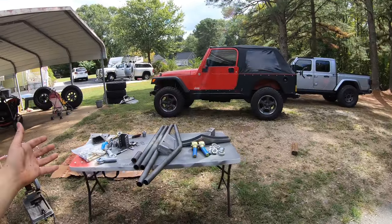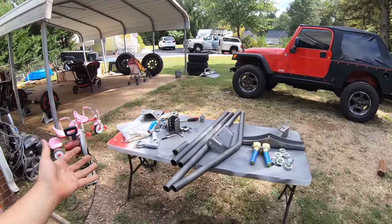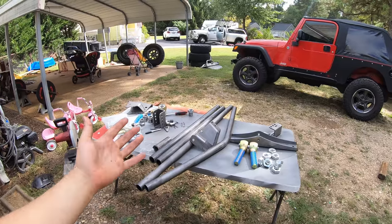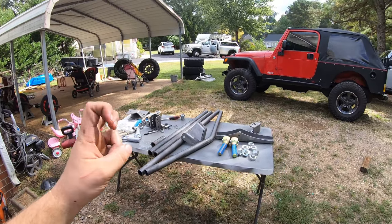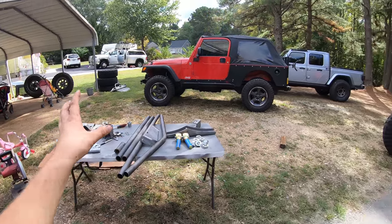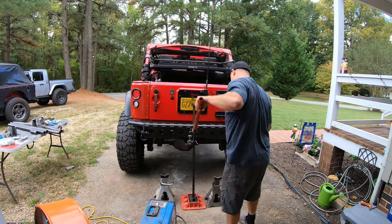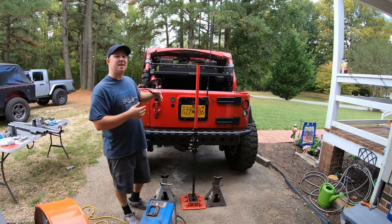The reason we weld and bolt in the new brackets before taking off the old control arms is so we don't have to remeasure — we just measure the distance eye-to-eye where we weld the brackets and go from there. So far it's going really smooth and hasn't taken that long. It is definitely a little bit labor-intensive with all the grinding, welding, and semi-technical stuff, but this kit makes it easy. Since we're going to be under the Jeep cutting, grinding, and welding, we jack it up and put jack stands under the frame for plenty of room.